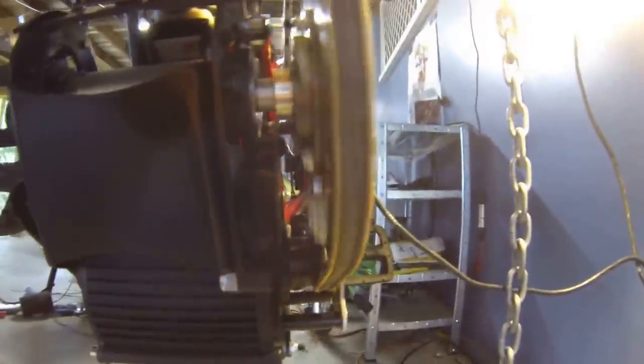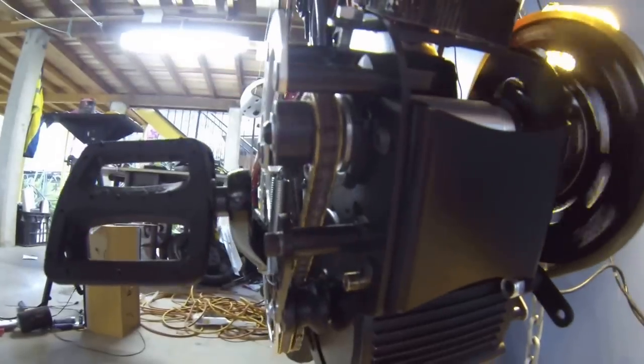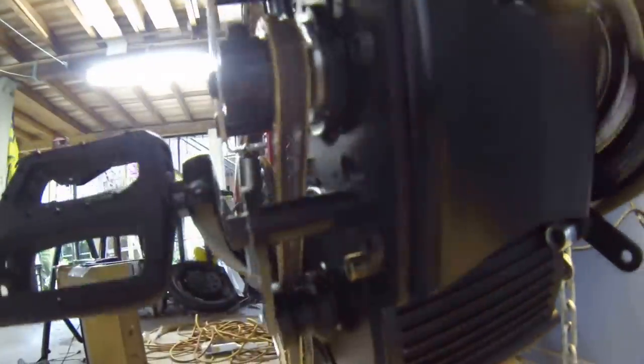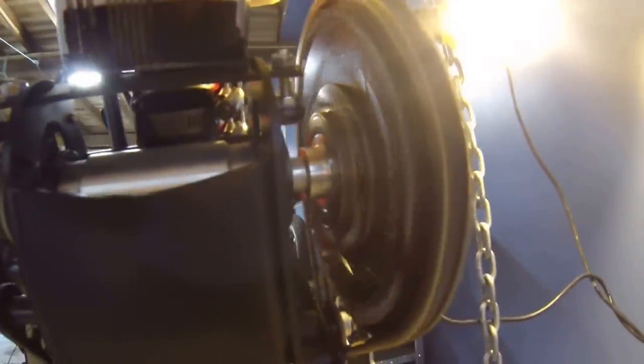I don't have a torque arm on yet, so I'm intending to take this off anyway and put in a smaller chainring. I'm just looking at that reduction and the amount of these two chains' separate speeds. If you have a look at how fast that's spinning compared to how fast that's spinning at the same speed - it's quite a lot of reduction. Quite slow spinning now - it's hardly turning.